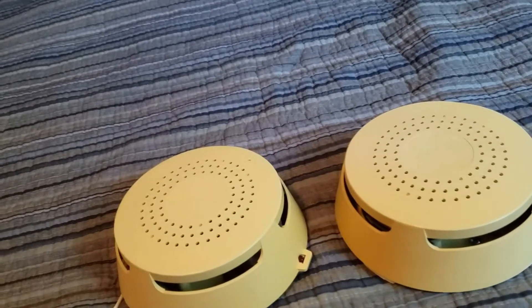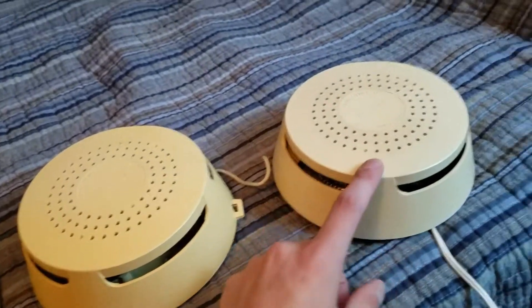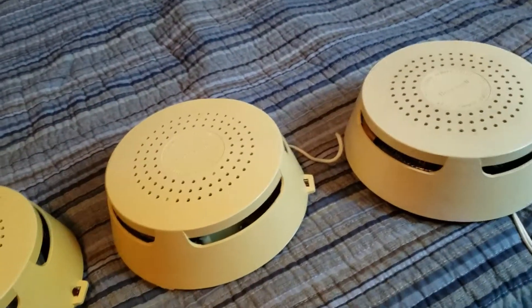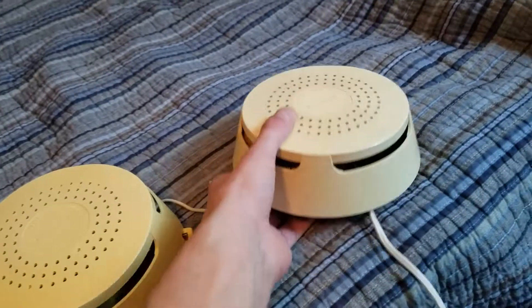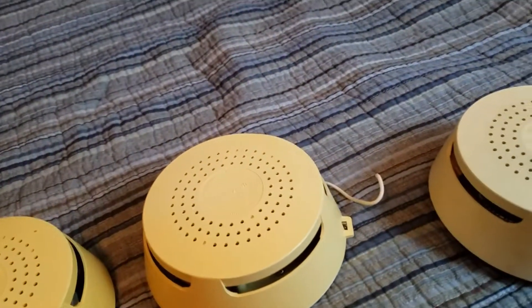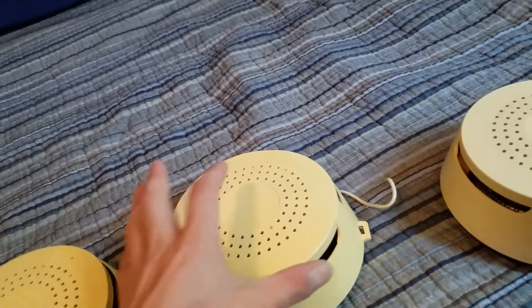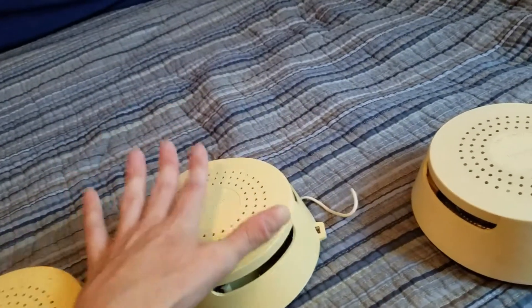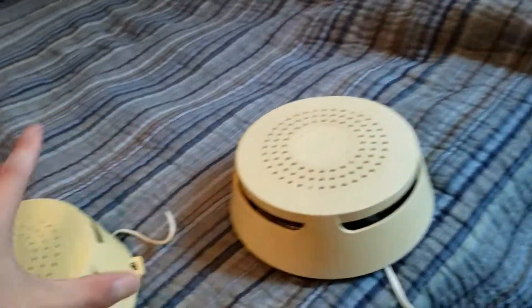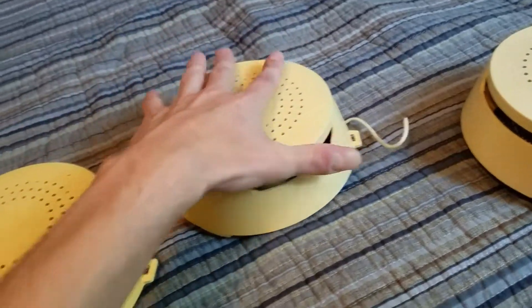For those of you who don't know, Honeywell had catalog numbers for all their models. These were all TC49A units but with different catalog numbers. This one is TC49A 1195, which was the line cord model as you can see. The TC49A 1054 was the version that had interconnect and a wiring harness. The 1005 was the direct wire model of the 1195 - it just had two pigtail wires coming out of it and no interconnect or ground.